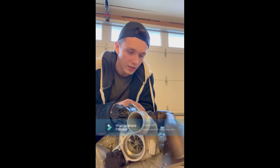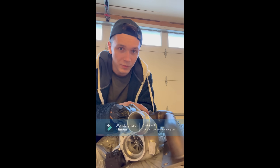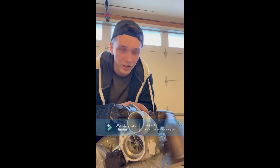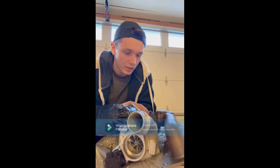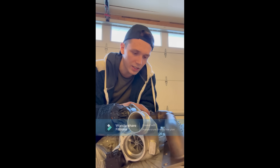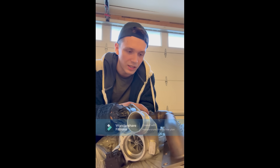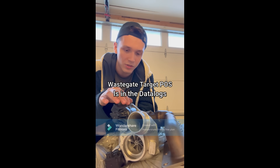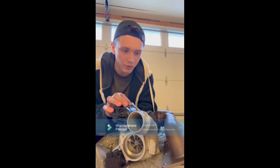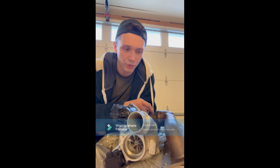So we did. That happened already after seven days of using this turbo. I adjusted the wastegate by around three millimeters, tightening it towards the actuator, using ISTA Plus. Everything was good. Continuing the tuning for another week, Chris also sent me a message asking to see the wastegate position in the data logs. I couldn't find it so we skipped it — but that was also a hint that Chris didn't understand why the wastegate positioning in the tune wasn't acting as expected.